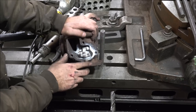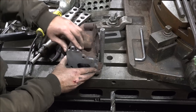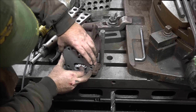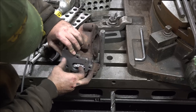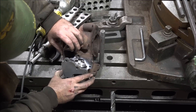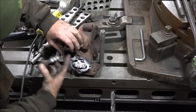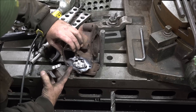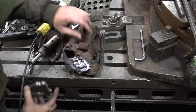I've got the Area Diesel plate that bolts on here. Area Diesel makes this 3/8 plate. You get that much opening versus normally you get that much, so that's a big difference on the inside, which is the side that the flow needs to go because the exhaust has to come around over here. What's hitting on the other side is really shrouded — it's not really going to escape, it's got to go up and over with a lot of turbulence. If it just goes straight, that's better. So this should be more better.